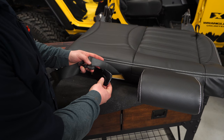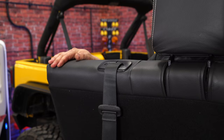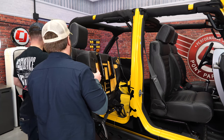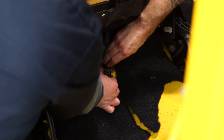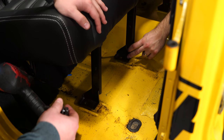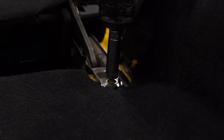Now reinstall the seat belt retainer — simply slide it over the belt and push it back into place. Attach the seat back to the seat bottom, get that hinge tightened back up, then put the seat belt bolt back into place and tighten it down. Tighten down the other bracket bolt, lower the seat down, put the brackets into place, and tighten down the bolts. Tighten down the back bracket bolts and your installation is complete.